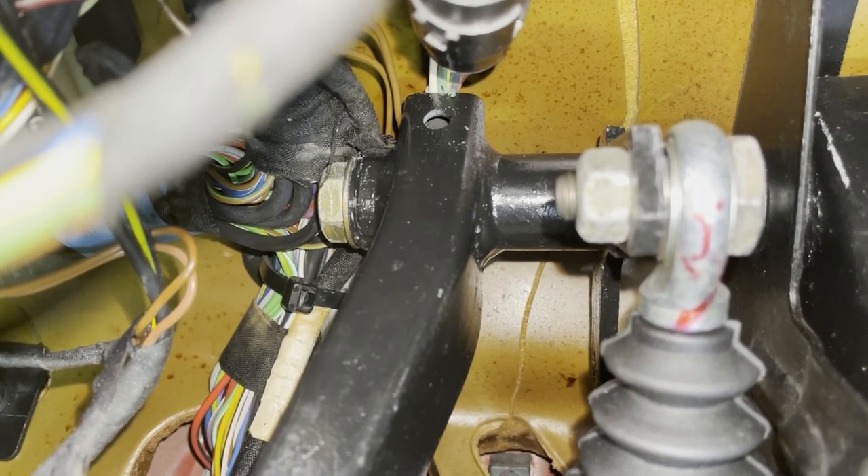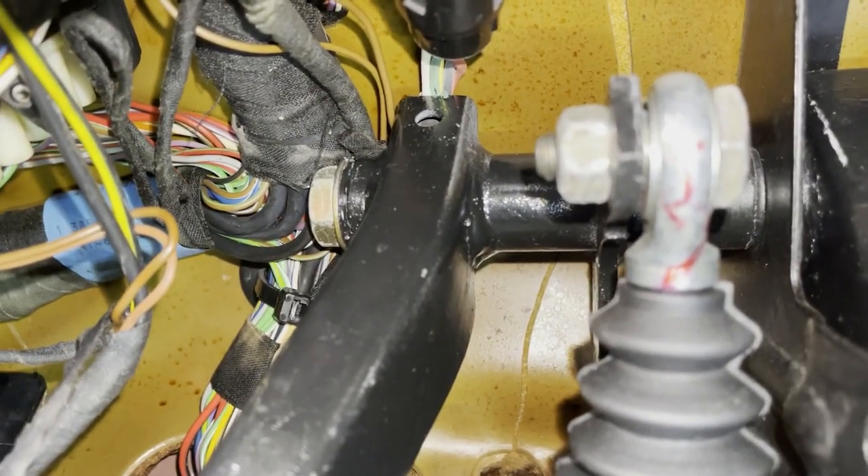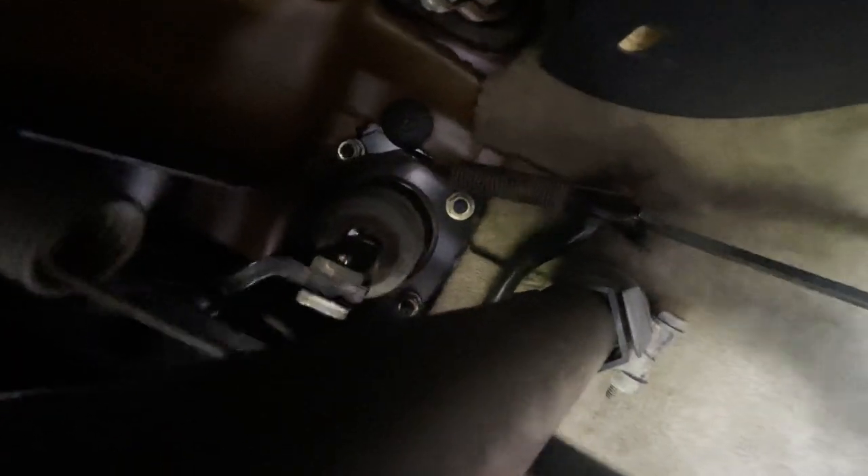It's going to be tricky because we have to get past that wiring harness. That bar right there is already pulled out most of the way but it's extremely difficult to get to because all the wiring is in the way. What you do is disconnect the brake pedal from where it's moving — you have to take a clip out — and then on the clutch you take a bolt and nut out to disconnect the two.